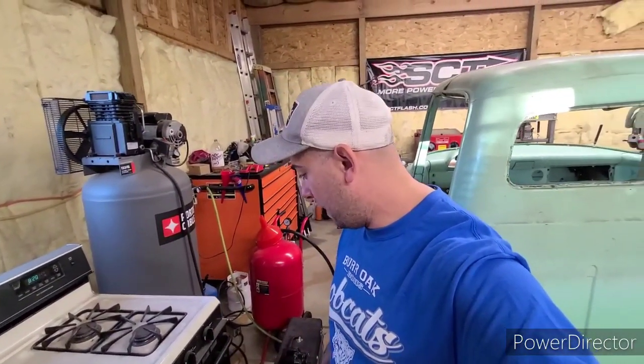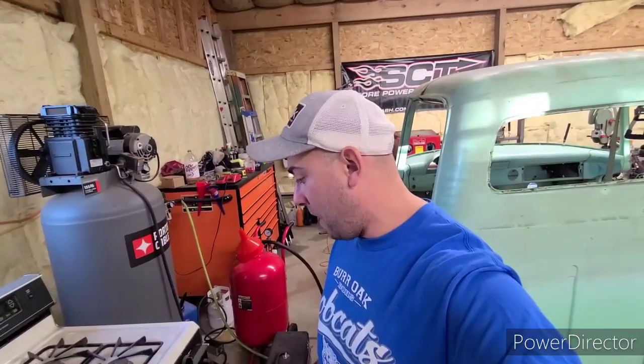I buy all my powder through Prismatic Powders. There are other companies, but Prismatic lays great. I haven't had any issues with it, so I don't plan on switching. They send you a sheet with each powder that tells you how long to bake it for. Most of them are 400 degrees for 12 minutes. That's 12 minutes after you witness flow. So as soon as you stick it in there, your timer doesn't count. Your timer doesn't start until you see it flowing.